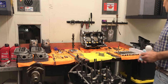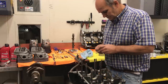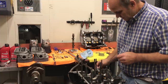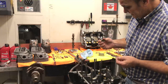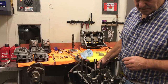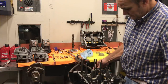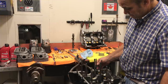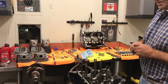We'll install the cam plug — make sure it fits, all cleaned up. I like to put the open side facing out. Some people like to put the closed side facing out — it's personal preference — but if you get something loose in the bell housing area, like a clip from the release bearing that gets tangled behind the flywheel, if the plug is turned this way it can rip a hole in it. Turned the other way, it has a little bit of protection. That's the only reason I put it in the way I do.